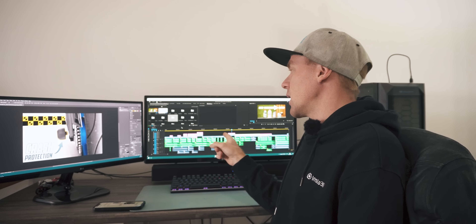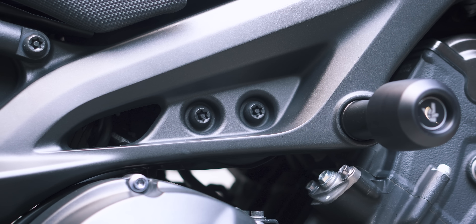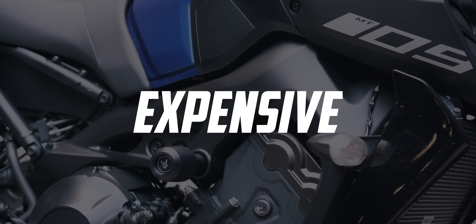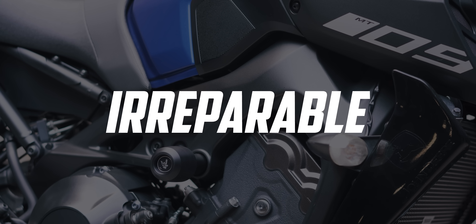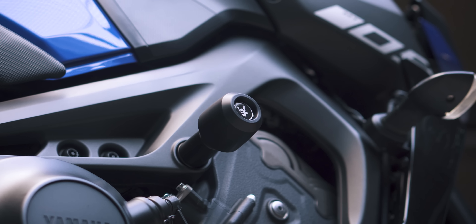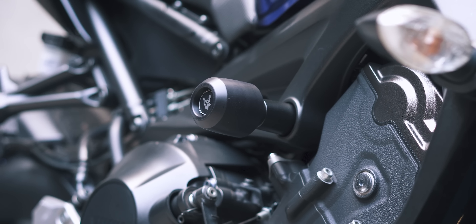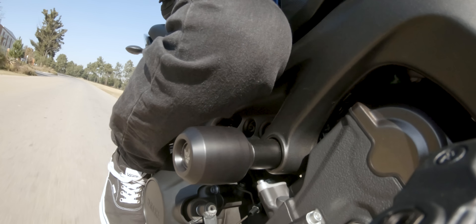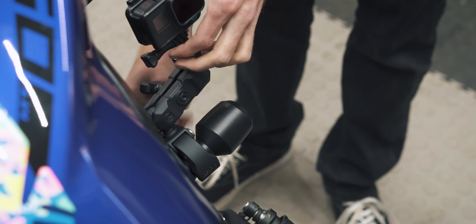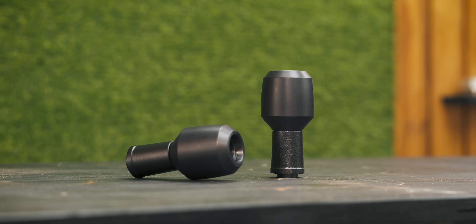So don't ask me how I managed to get them to fit, but I did get them good enough to film with for one day. But assuming that you got frame sliders that actually fit your bike, everything I've already filmed still applies. Their job is to protect your bike's frame in a crash. Fairings can be replaced, but a damaged frame is a nightmare — it's expensive, hard to swap out and irreparable. Not to mention it's the home of your VIN. The mount itself is very strong and the end cap is nylon so that it's low friction and slides along the road rather than digging in and doing more damage. Plus it gives you somewhere to mount your cameras. I just wish I had a pair that fit my bike.